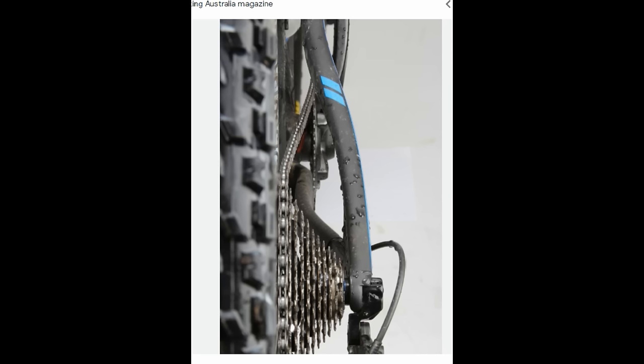What we can see though is that as we go up to the larger cogs on the cassette, we're running not a straight chain line — it's going on an ever-increasing angle. That final chain line angle is determined by a few things: your frame is one, but also your chain ring and cog size. A larger diameter cog and larger diameter ring will basically hold on to the chain for another link because of the larger diameter. So if you're running a 28-tooth cog versus a 52-tooth cog, that will hold on to more chain for longer and give you a more extreme chain line angle.